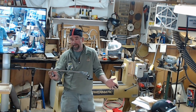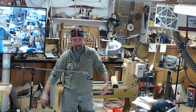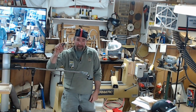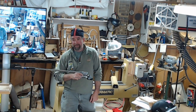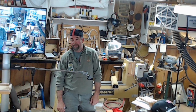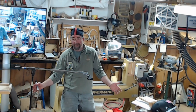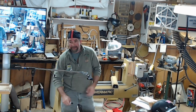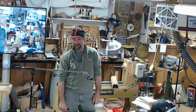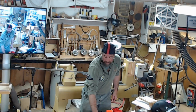Can you do it? Sure. Done it all the time. I've even had, with that 32-inch bar, a 48-inch piece of wood that I had to go from one side to the other. And the scariest is being in the tree with an 066 and a 32-inch bar while the crane's plucking out a 5,000-pound piece of wood over top of your head, and you have no place to go because you're strapped to the tree. It's not fun. But I'd rather make a clean, quick cut than a slow, dirty cut where I'm strapped to the tree or within an area where I can't make a run for it.